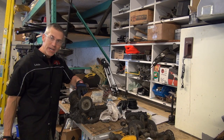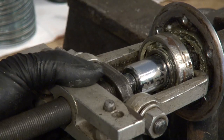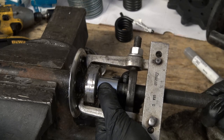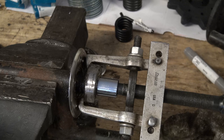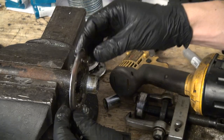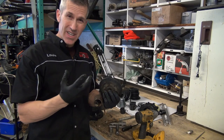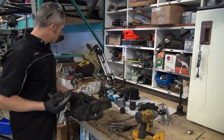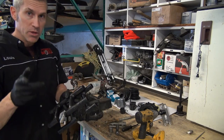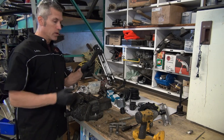You don't want to crush these too hard because the ones pre-1972 are actually thinner and they bend quite easily. This single bogey up front is a little thicker than most, just because it takes a little bit more abuse up there. I'm going to do something a little differently — I've got some new old stock arms, so I'm going to use these instead. I want four bogeys up in the front; it's going to be a little better than three. Keely's riding these sleds and some adults are riding them too, so I want a little bit more support in there.